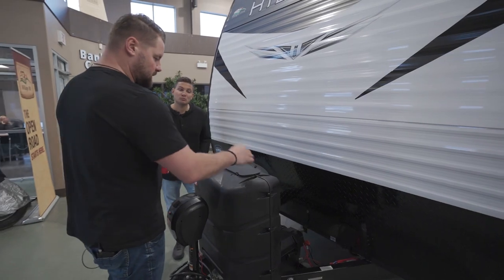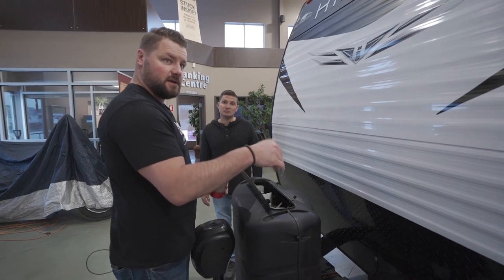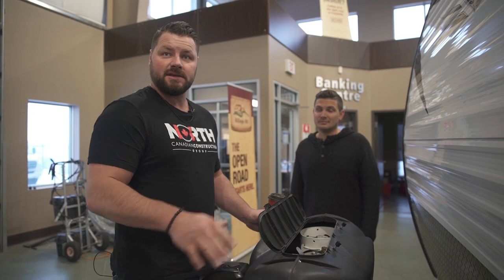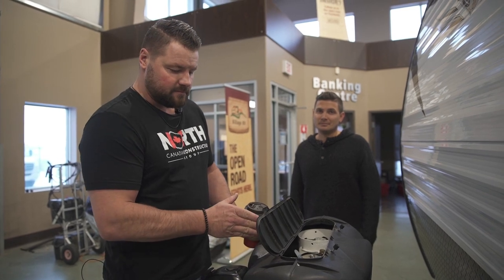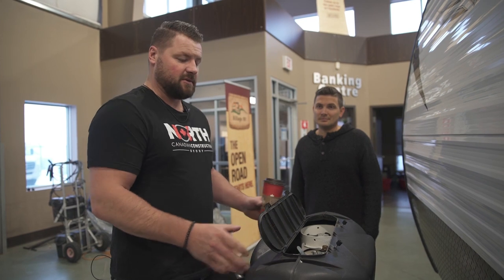When you are using and renting the unit, turn this just to one tank. Pick one tank and use that, so that you know you're only renting this for a short period of time, most likely. So the reality of you using both these propane tanks is unrealistic, and maybe not even using them at all. But if you are going to use the propane, flip it to one tank so that you only have to replenish one tank versus trying to replenish both.